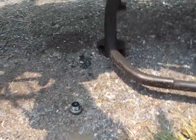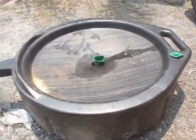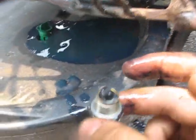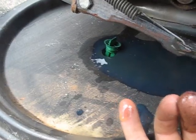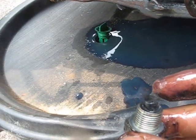Now I'm just going to pull the drain plug — it's right under there. I'll get a socket on that, pull it off, and drain into my pan. You want to take a look at what comes out. This oil coming out is still clear; it's got that blue sheen that this weight oil usually has. That's a really good sign. There are no metal flakes coming out, no junk or anything like that — that's all really good.